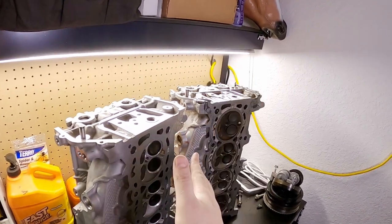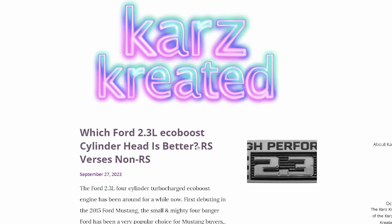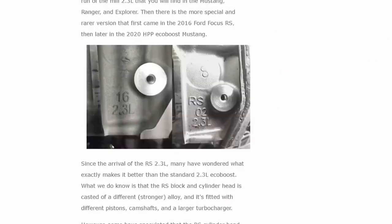Get yourself a nice 2.3 cylinder head, save that money, put it towards a better block and a built bottom end. Get that thing tuned, make the power, and have fun. This was a video I've been wanting to make — I wanted to compare the differences so people know, so this information is out there because I couldn't find it. You go on the forums and no one knows. So I'm going to take pictures of all of this, take my measurements of everything I just showed you, and put it in my blog — the Cars Creative blog, link in the description. You can go there and see the write-up on these cylinder heads, the specs I've measured, pictures, and the similarities — or differences — between the two. That way the right information is out there for anyone curious to know the real differences between these two parts, which is nothing.